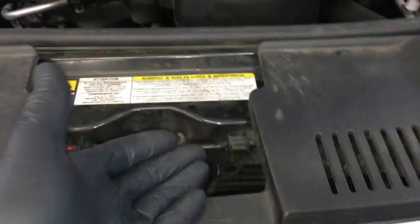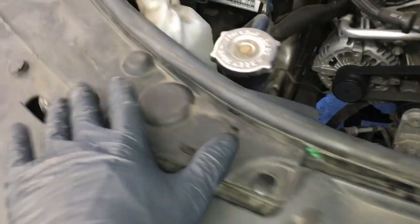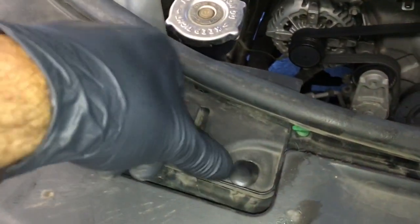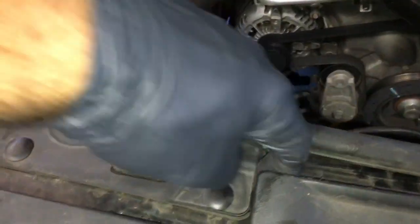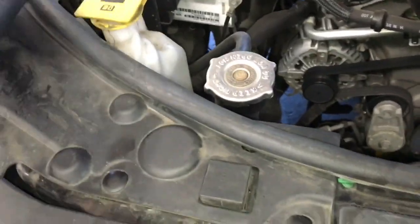After removing the Freon, put your finger underneath the panel right here next to the hood latch and pop it up, all the way across the grill so the grill flares back. Then pop the panels on the left and the right side — there are two panels. Use a little pry tool, put it underneath the push pins, and pop them up to lift the two panels off.